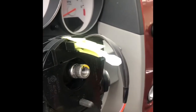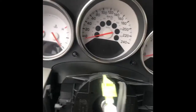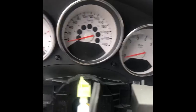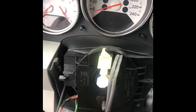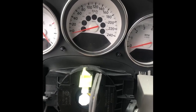This part here is the guide — it prevents the clock spring from rotating. Do not remove this lock yet until you've finished everything and put it all back together. You can also keep this lock as a special tool for future jobs. Label it for the model — like Dodge Caliber — because some clock springs share the same lock.